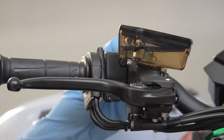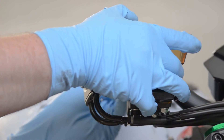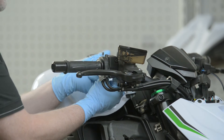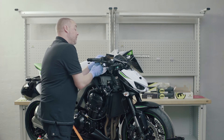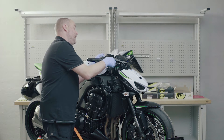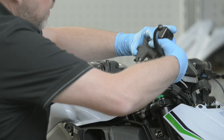To know which is the correct master cylinder I need to know what master cylinder I have on the motorcycle in the first place. So I'm going to take this Nissin master cylinder off the Z1000 and have a look at what piston diameter is stamped into the bottom of the cylinder. There will always be a piston diameter on the bottom of the cylinder — on a European model it will generally be given in millimeters, and on a Japanese model like this it will generally be given as a fraction of an inch.